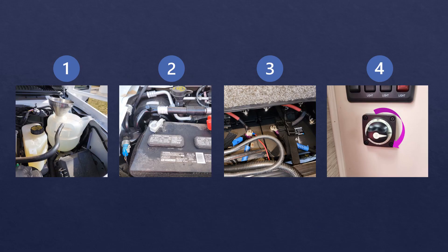With all of that done, it was time to put everything back together — refilling and attaching the interface container, reattaching the truck battery negative lead, reattaching the house battery negative lead, and then turning on the battery switch. The lights turned on and the truck started up right away, which was something to be pretty excited about, because up until that point I wasn't quite sure. So I grabbed my husband, who agreed to drive so that we could monitor the batteries.